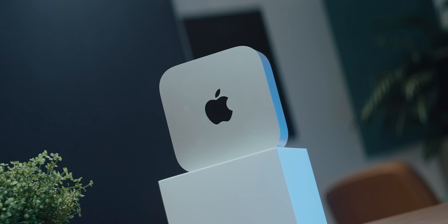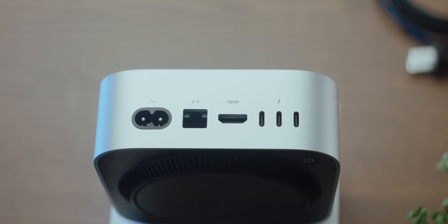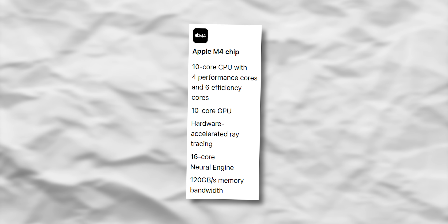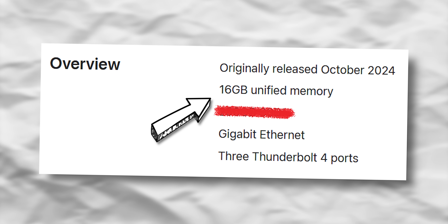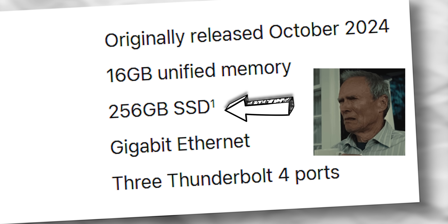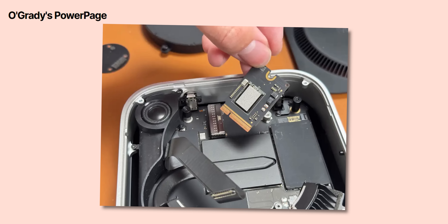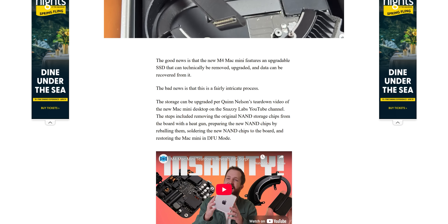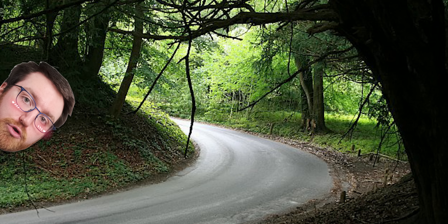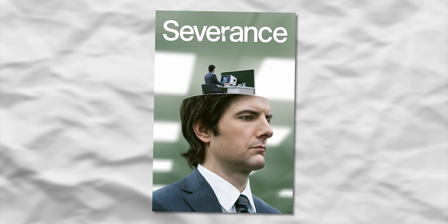In terms of specs, this is the base M4 Mac Mini which normally sells for 800 Canadian dollars, but going refurbed saves you 120 Canadian dollars — which, going by the surface condition of this Mac Mini, is a great deal. However, you're only getting 16 gigs of unified memory and a 256 gig SSD, which for a modern system is very little. What makes it most annoying is that despite using M.2 storage, it's BIOS-linked, so the only way to upgrade it is through some unholy combination of black magic and voodoo. That's the kind of business decision Skeletor would make — and if you want to step up to 512 gigs, they charge 200 US dollars for 256 gigs of storage in 2025. But I can't be that mad at Apple because they did pay for Severance to happen and that show is tight.